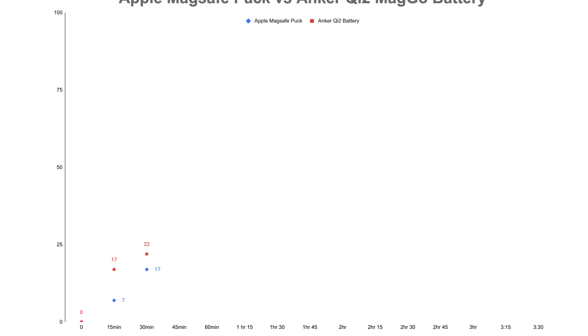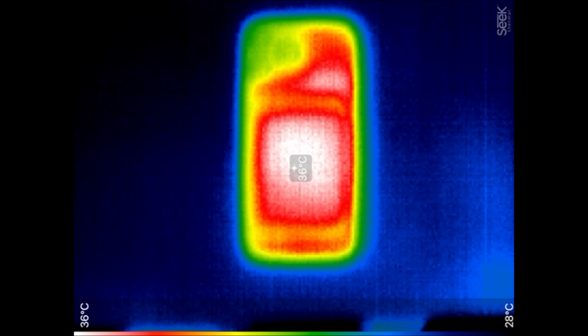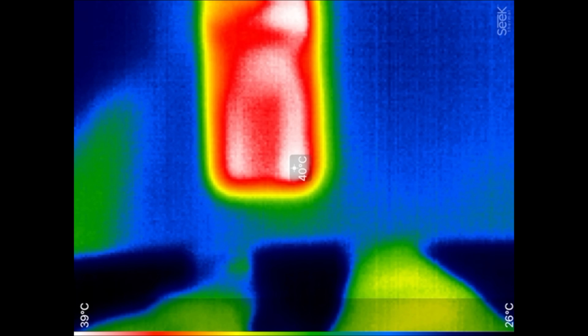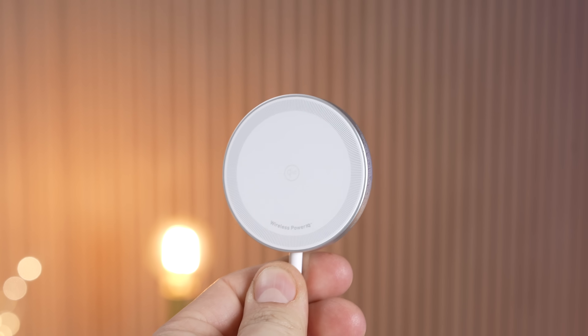At 45 minutes, Apple reached 26% while Anker only gained 6 points, so they were getting very close. I pulled out my thermal camera and got 37°C maximum for Apple — the same on the back of the phone, consistent with other chargers like their official puck. Anker hit 40°C on the battery pack and the iPhone had more heat overall. With wireless charging your phone heats up, things slow down, and that's what's causing this to not run like it should.